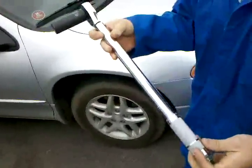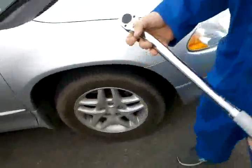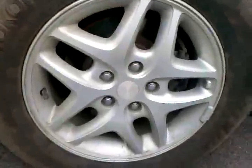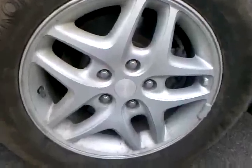In this video we're going to demonstrate how to use a torque wrench to tighten down a nut or a bolt. The first step is to find out what the torque specification is for the nuts or the bolts that you're going to tighten. It happens that the lug nuts on this wheel have a torque specification of 95 foot-pounds.